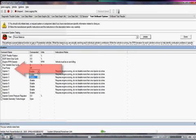As you can see, we've got the fuel pump off. We can go to it and we can run each injector in turn. This tells you it requires the engine to be running and do not disable more than one injector at a time. So they laid out the rules for you. We've gone down and picked this up. We simply click on the box, enable or disable over here with our box, and we can turn injectors off and on.